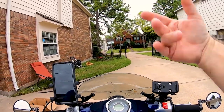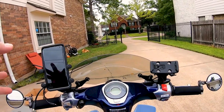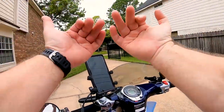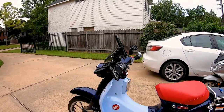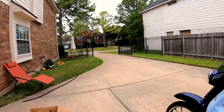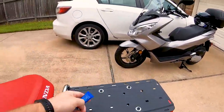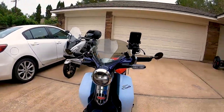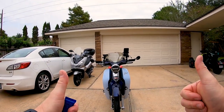The GV was causing a little too much buffeting and helmet turbulence, so I didn't care for it. In its configuration with the tilted mount and also the height, most of the wind was cutting off right here by my chin and it was causing too much noise in the camera and helmet buffeting. So if I put it back on there, I'm going to fix that mount and I'm going to cut it down probably two inches, just so the wind terminates a little lower than my helmet. Anyway, here we are — back to the cafe look, kind of, sort of. Thanks for watching.